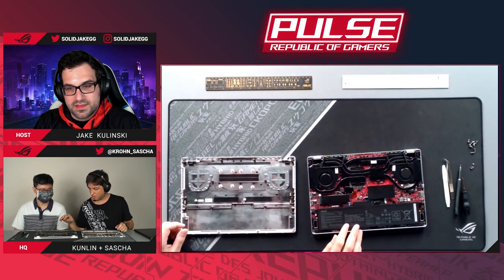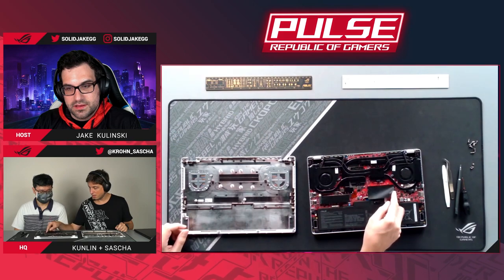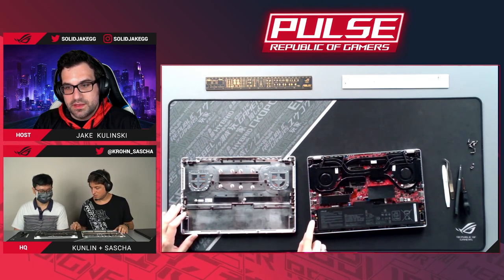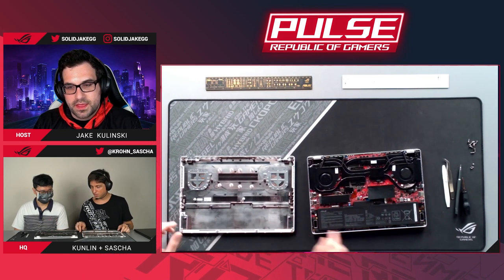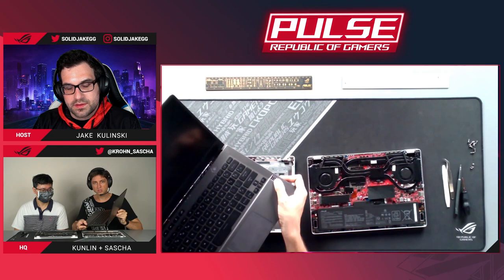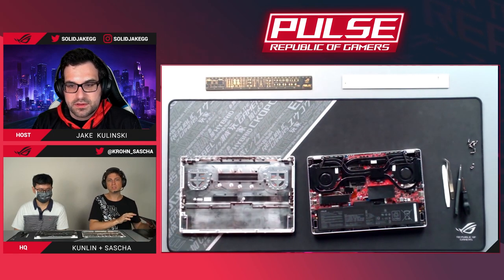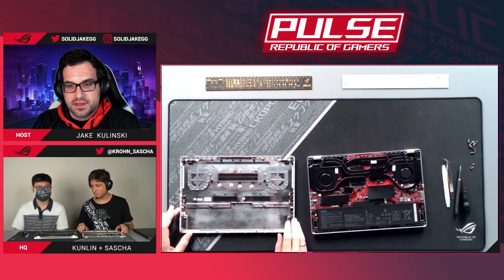You can see the battery down here, the SSD covered by mylar tape, and the memory module. This is an M.2 slot and then memory chips. Down here we have four speakers — two firing down on each side, and two more tweeters facing up on the palm rest for high-frequency audio. You want the high-frequency sound to be directional, pointing straight at you, while lower frequencies come from under or the side of the laptop.